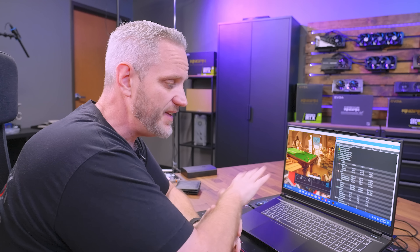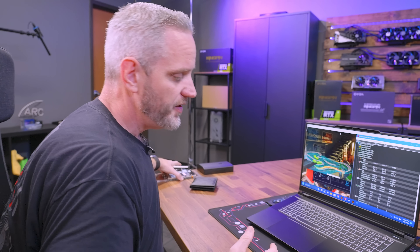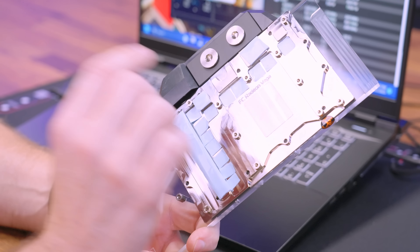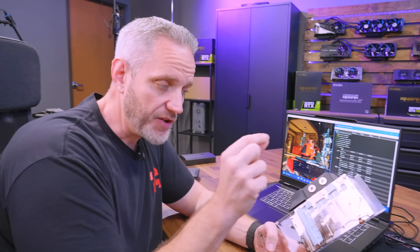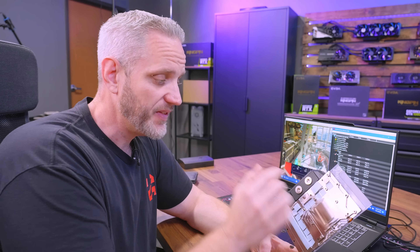I don't think I need to take it apart and repaste it, but I'm going to anyway because I'm 100% curious how much that thermal paste has spread on the RAM. If it still looks like a dollop and hasn't spread, we'll know there may have been some hotter parts of the RAM. What I plan on doing is using an old EK water block Vega pre-cut RAM chip half-millimeter super thin thermal pads. What EK used to recommend back in the day was putting the thermal pad on the chip and then a drop of thermal paste on top of each pad. I'll do pad and thermal paste, let it do its thing, and then we'll check the temps.